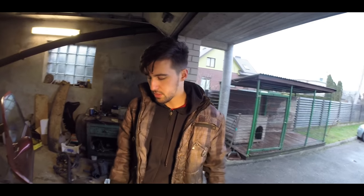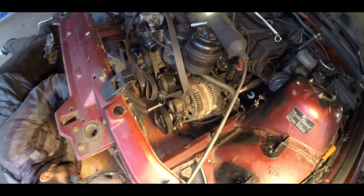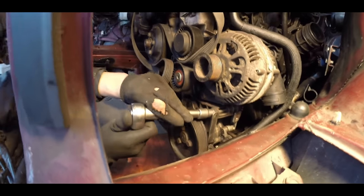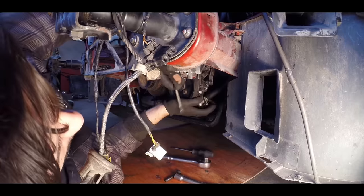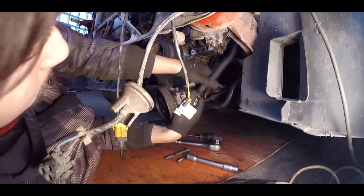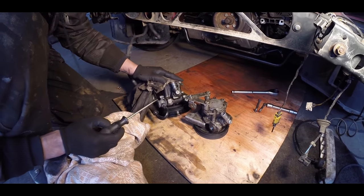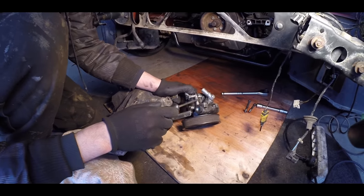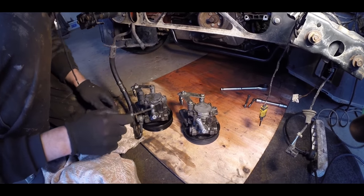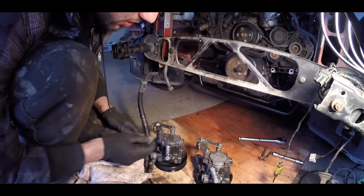Now we should remove the power steering pump and reassemble everything, then we'll finish that hose in the installation. If you notice whether there's a leak on your pump or not — I just took it off. If you see there's a lot of black stuff all around the hose contact area — this one's clean, but the other one wasn't. That means the last hose that was put on here was leaking, probably because it wasn't tightened enough.